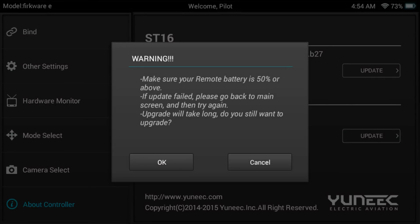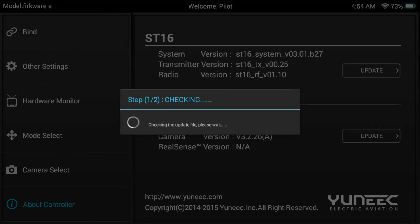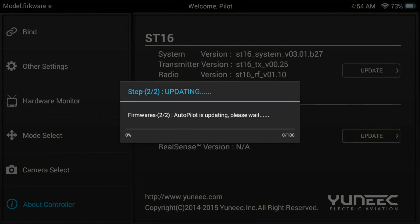Now, in this event we do have numbers, so we're all set to update. So we're going to go ahead and press Update. From here it's asking OK or Cancel — just press OK. And now it says Step 1 out of 2 Checking. We're just going to wait and fast forward this video and come back right after it's all set. But I want to point out one more thing: if you go ahead and update without having any of those version numbers, it'll say 1 out of 2 Checking, and it might get past that and update, but then it'll only say Updating 1 out of 2 or 1 out of 4 and won't go ahead with the complete update. So again, make sure you have those numbers.